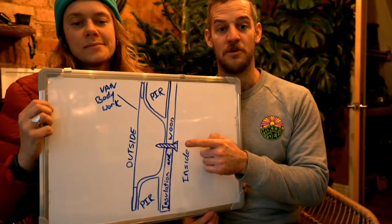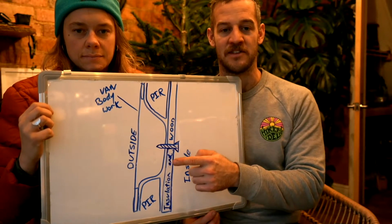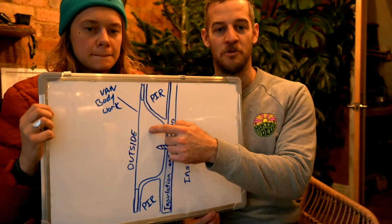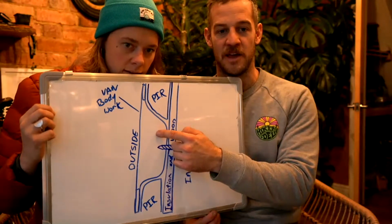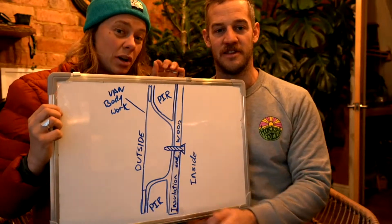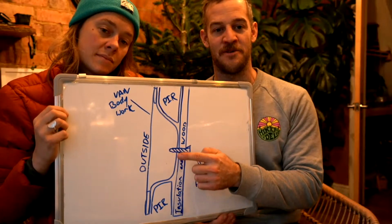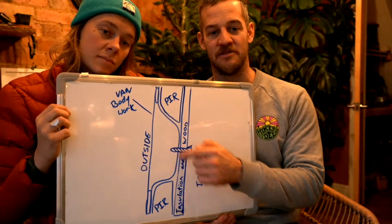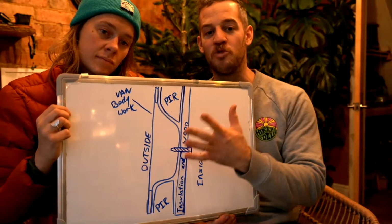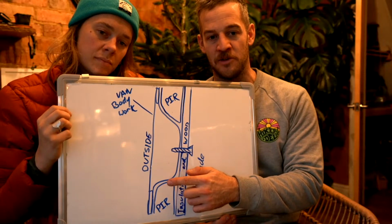This is also why you shouldn't shove insulation into the cavities. Some people will put bottle insulation foam in this bit here. I've spent hours doing that in vans. They shove it in with a little skewer, but what's really happening is the cold is just going around it, and it's completely voiding it. You waste time. It will do something, because there are these little rubber gooey blocks that sometimes they glue the internal skin on.